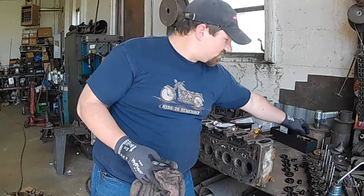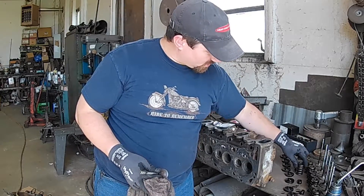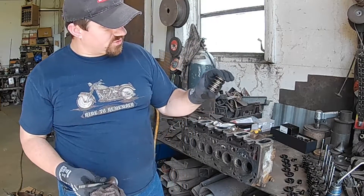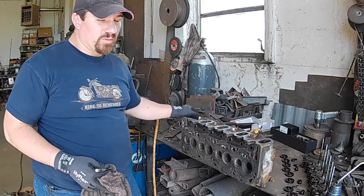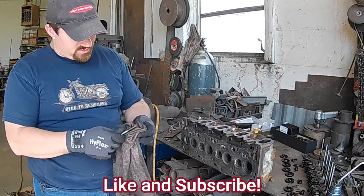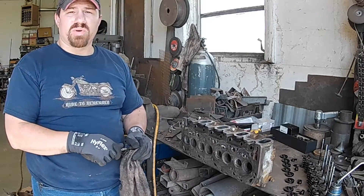That's really going to matter because here we're actually going to use a little bit stiffer valve spring than the factory ones — these are Ford Power Stroke springs. I recommend it as an upgrade on these IDI motors, especially if you're going to run a turbo. Thank you guys for watching, and like and subscribe — we really appreciate it.